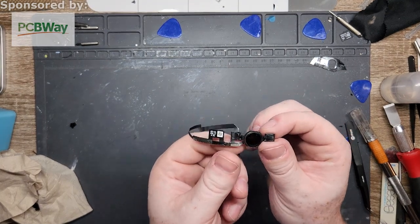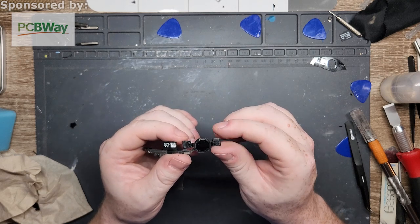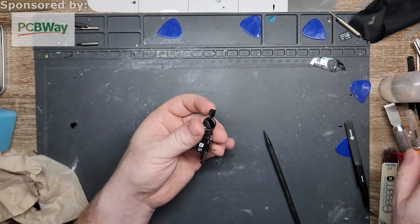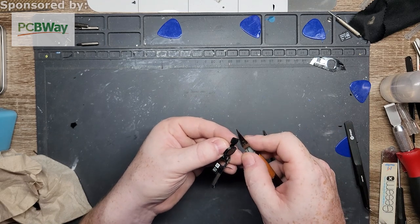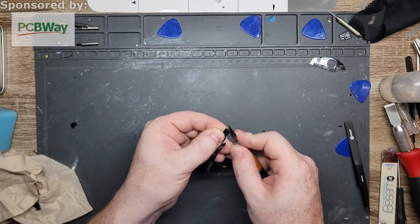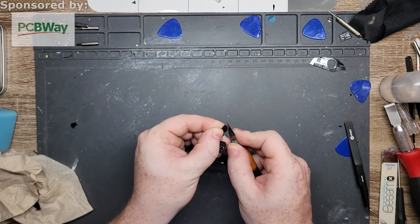The brackets on these, if you notice, they're sticky. They're really, really sticky. That's a little of the extra adhesive still left over, so we do need to take that off, otherwise the glue that I use won't stick to the glass and then to the adhesive, because then it'll just kind of eat away at it and then it'll fall off. So I take an X-Acto or a scraper, however you want to do it, but you just want to get rid of a good chunk of it.